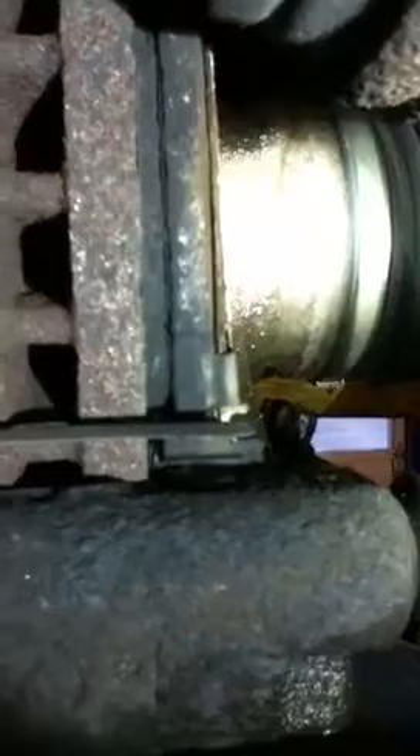So I'm going to get you an estimate on replacing that and doing that service. I'm also going to get you an estimate on brakes. If you can see here, your front brakes are worn very low. That is the inside brake pad. Roughly it has about 2mm left, which equals about 5%. They should be replaced when there is 20% life left.